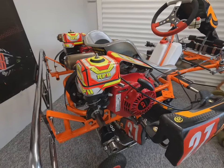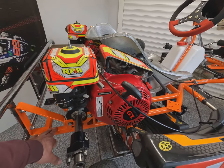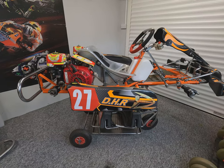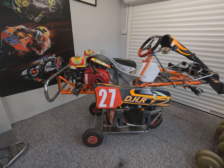With no suspension on these karts, most of the suspension is in the tubes of the chassis and the sidewalls of the tyre — that's where you get the majority of all your suspension movement. So that's a short bit about the principles of how the kart goes around a corner.